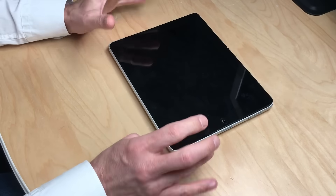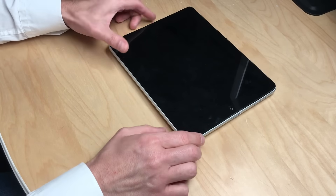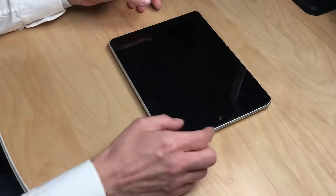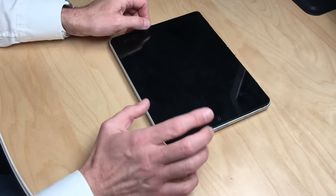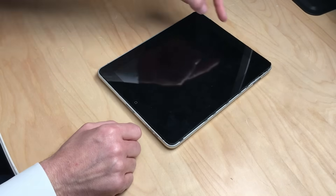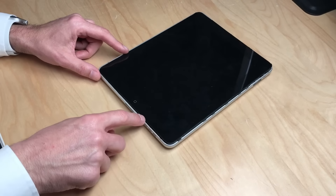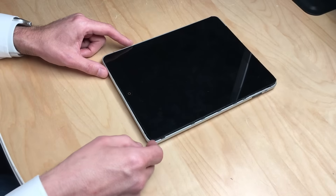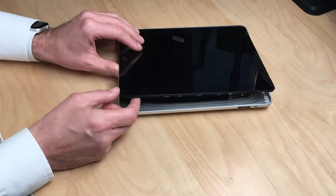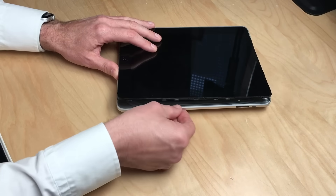I thought this is a pretty nice display, so why not turn it into an external monitor? To do this you have to open the iPad up, which I have already done — as you can see it's a bit scratched. First you have to cut with a knife around the edges where the black line is, as there's some kind of rubber seal to break, and then there are plastic tabs which hold the display assembly inside the aluminum shell.